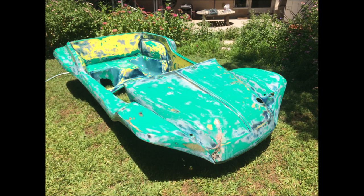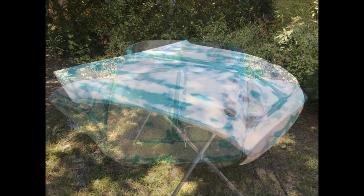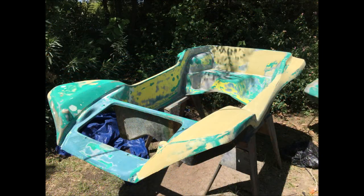This new one's actually a pretty cool story in itself. We picked this one up in a fairly severe state of disrepair with some major cracks and other damage to the fiberglass, and my dad actually went through and completely restored it. He replaced all the broken sections of fiberglass with fresh material, did the layup work for the fiberglass compositing, and restored it to an excellent condition that we could then use for subsequent parts of the build.